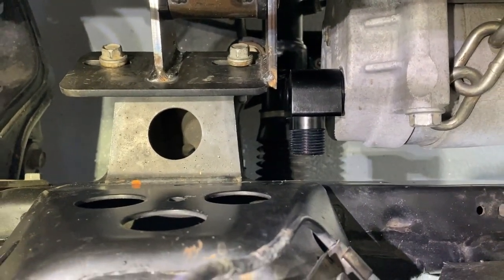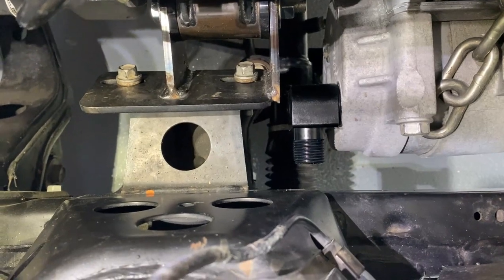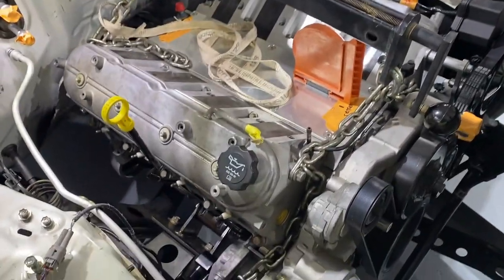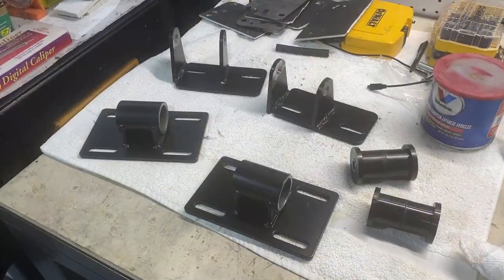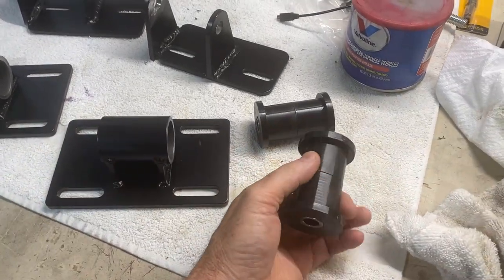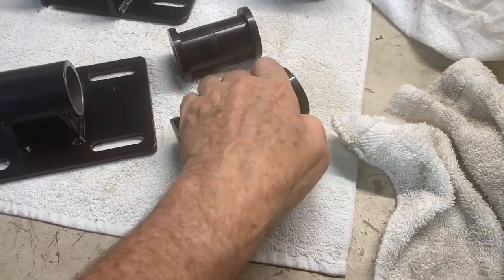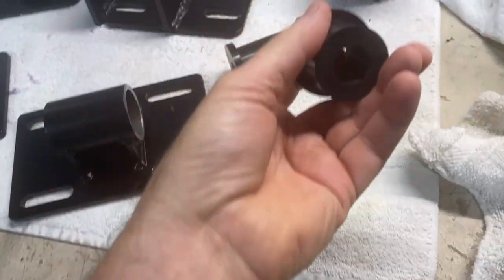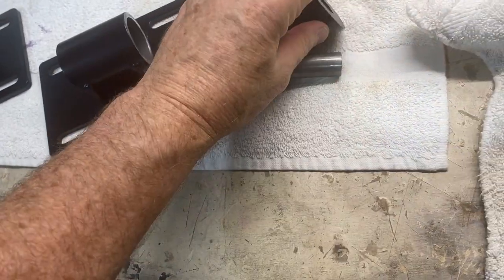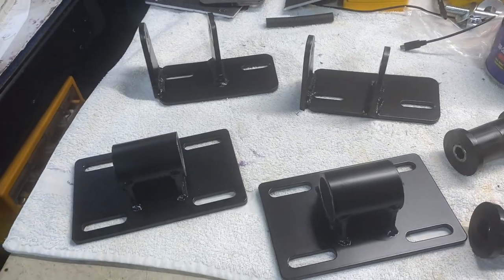You just don't know — sometimes when you buy parts early, you find out later they're not going to work, and it's a little too late to return them. This one's not an expensive part, but yet another part that probably will not get used. For today, this is it as far as getting the mounts made — they're good. We just got the parts back from powder coating and they look really nice, in a matte black. They're urethane bushings, so we've got some high-temp grease. When we put the bushings back in, we'll put a little grease on the inside where the little convolutions are, a little on the outside, and a little on the outer edges inside the brackets — just in case there's any movement, there won't be any squeaks.